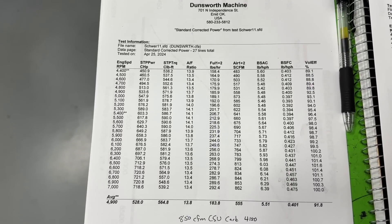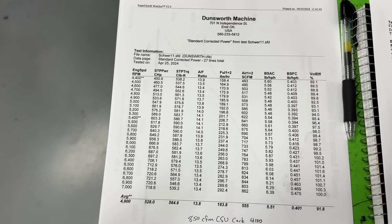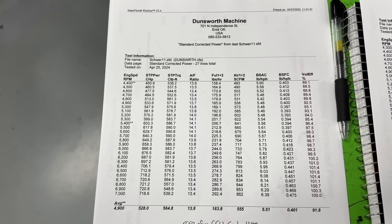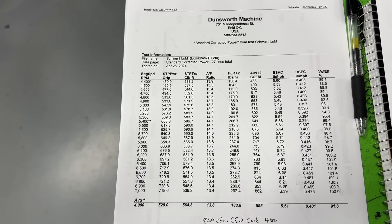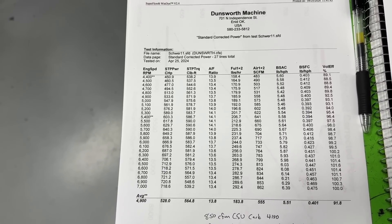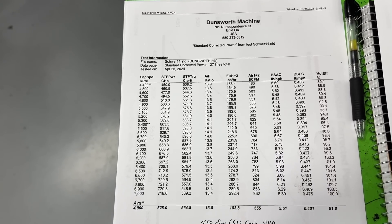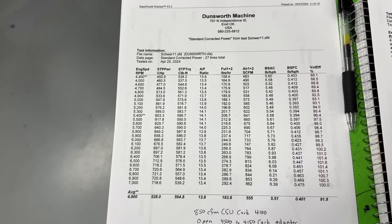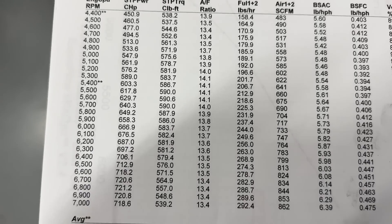This ended up being around 36 degrees of timing. Another mistake was the timing pointer was in the wrong spot so we couldn't tell exactly, but we know it had way too much timing early on — at some point we'd take out four degrees of timing and gain 20 horsepower, and kept doing that. Luckily it could have been bad, but this is the reason why you should run really good fuel whenever you're doing any testing. Anyway it looks good — you get 720 horsepower.